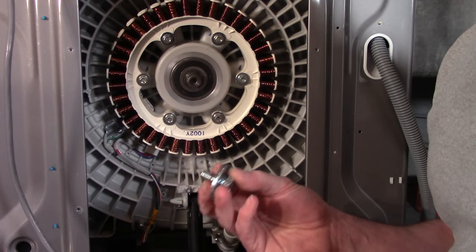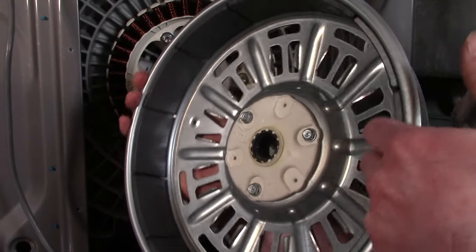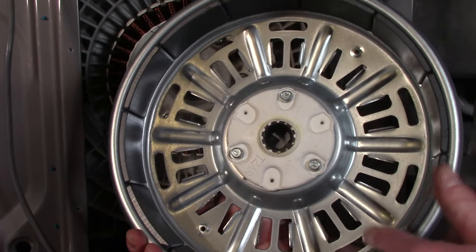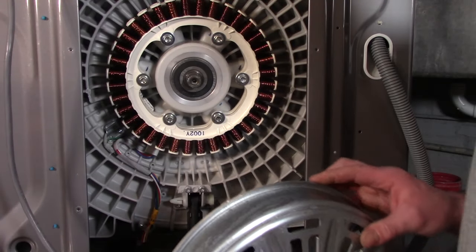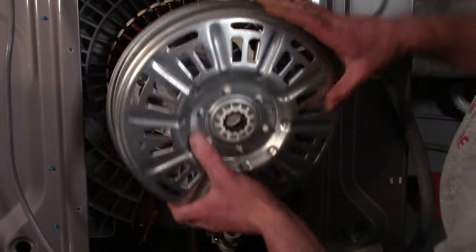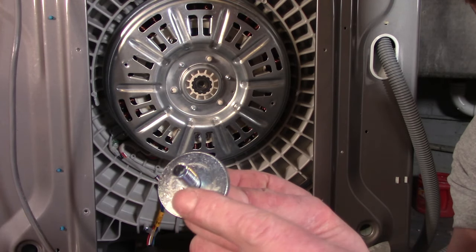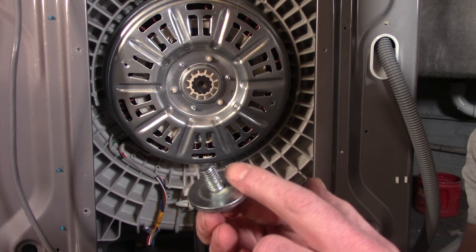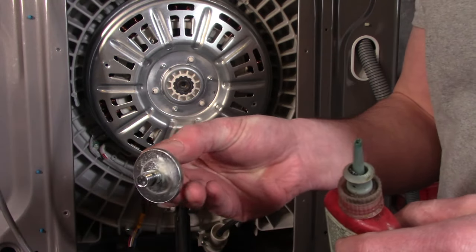Put the remaining bolts back on, then remount the rotor assembly. Make sure nothing got into the rotor — the clearances are very tight, so any metal debris will make for a very noisy machine. Be careful putting it in because the magnets will draw it in, so watch your fingers. It's a good idea to put a little Loctite on the bolt — there is a locking washer and some residual Loctite on the threads, but if you have some it's definitely worth using.